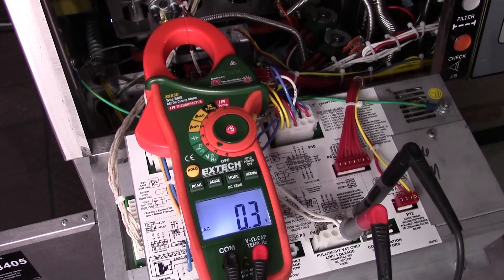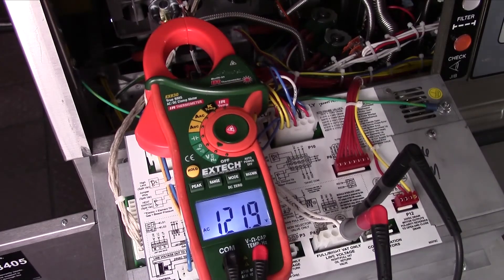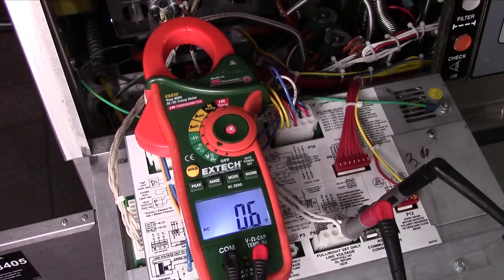When the vat is turned on, line voltage should be present at this connection. If you have voltage and the blower is not turning, check to make sure there are no wiring issues, and if none, replace the blower. In the more unusual circumstance where there is no voltage present at the control when the heat light is flashing two times, then replace the control.